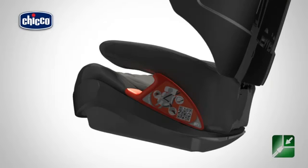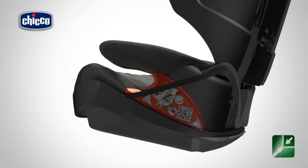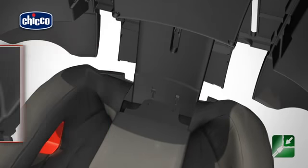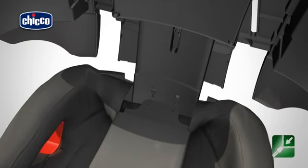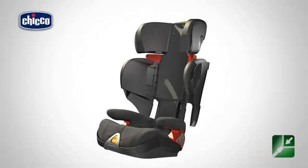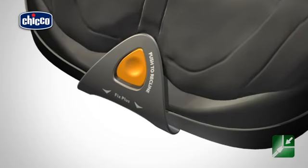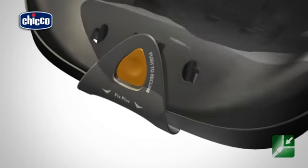Open the velcro fastener on the back of the seat. Pull the fabric cover so the elastic is taut, then remove it from the lap belt loop on both sides. Pull the central protection upwards, releasing the toothed fixtures from their seats. Pull the cover up over the armrests and remove it. Remove the fabric lining of the seat, pulling it from the triangular plastic reinforcement upwards.